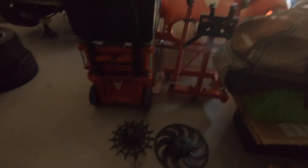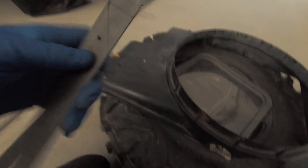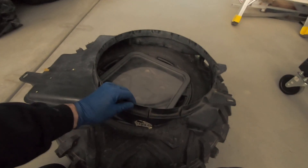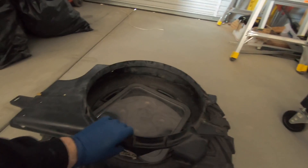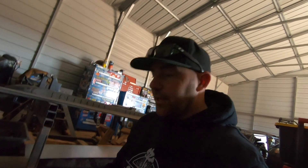I was figuring out how to mount the fan. What I did was cut out the stock fan and this piece of the shroud, using the five-liter mounts that attach to the five-liter Mustang fan shroud. My plan is to cut off those tabs and screw the fan to this shroud. The shroud was only about $20 on eBay. I may just run it as-is and see how it goes. If not, Breeze Automotive makes an aluminum shroud — not that expensive — so I'll try this first.